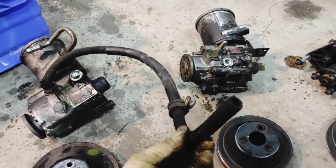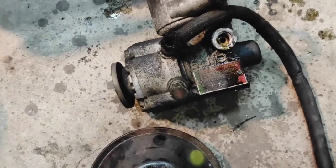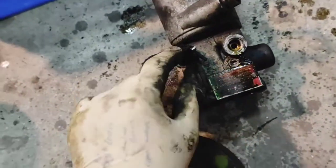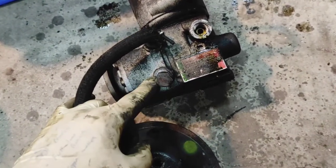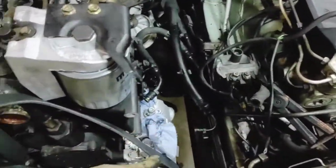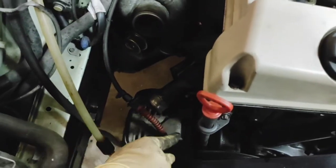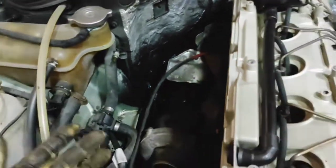This one still has the hose that went to the SLS suspension reservoir, and then the suspension hose goes around underneath the engine, back over to the left-hand side. On the M103 it sneaks up by the alternator and then comes around to the pressure port - that's your pressure feed for the SLS.